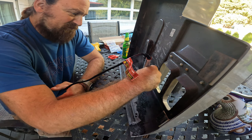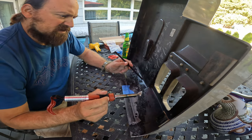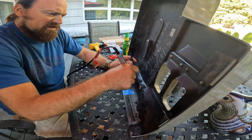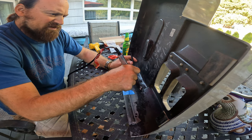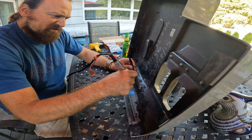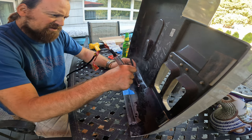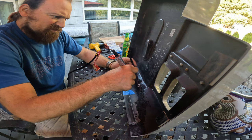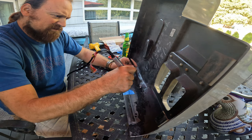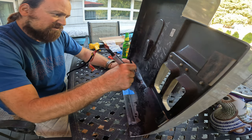You just sit here for about an hour, maybe two hours, slowly melting plastic and pushing the mesh in. Because there's a big gap, I've also been using the welding rod to backfill a little bit from behind the mesh. You put the heating element down onto the rod and melt it until it turns to goo, and it just fills right in the back — you can spread it around as long as it's hot and liquidy.